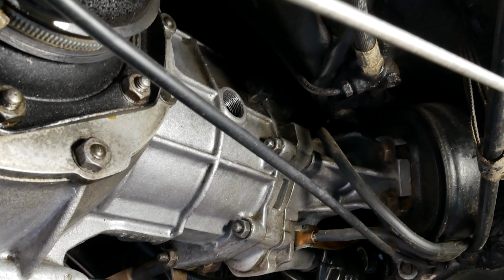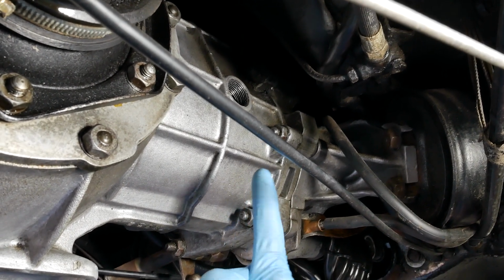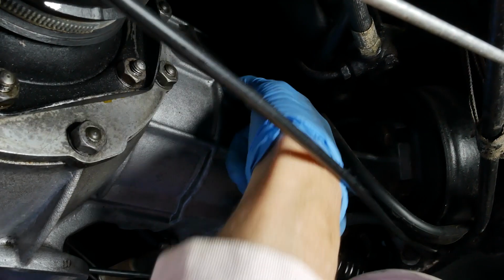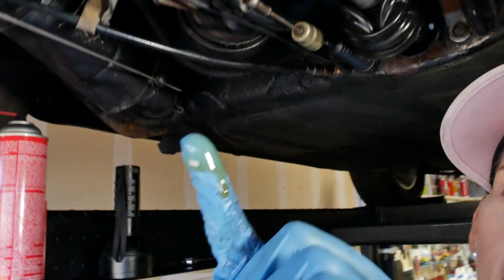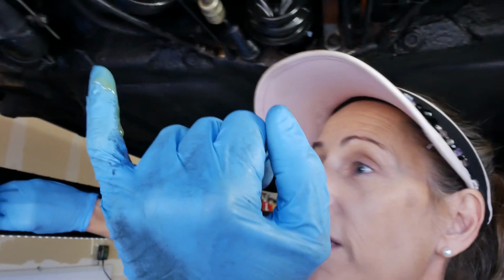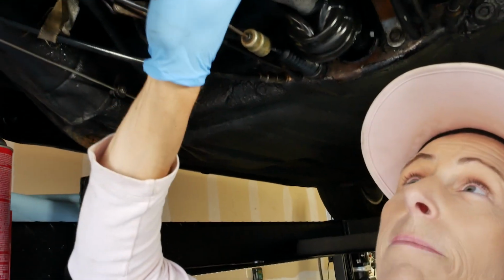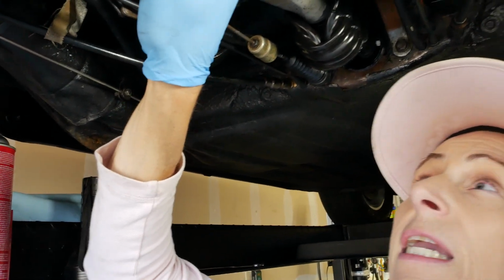So I'm going to put in a clean pinky here, and let's see how far down our fluid level is. My oh my. Okay, so I buried my pinky and I did get some oil, but barely any at all without actually touching one of the surfaces in there. See, no oil. All right, so that's super bad. So the level is probably at least below this rib here. This is about as far as I can get my pinky down there.